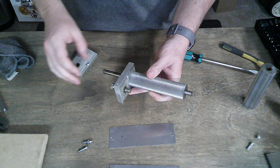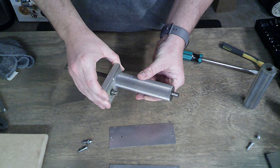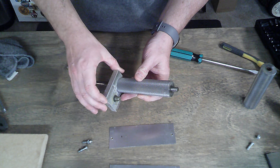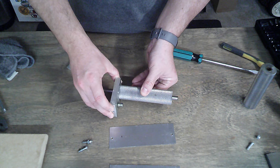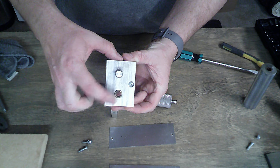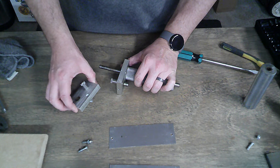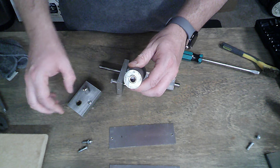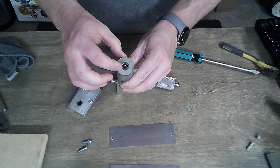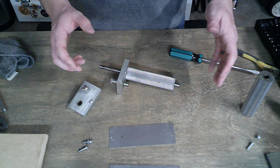At the beginning of the video I talked about using a little bit of vegetable oil to loosen things up, but you don't want to do that as you're putting it back together, because any type of wet lubricant can actually collect that dust and get stickier over time. Instead, these actually have self-lubricating brass nuts on the inside of each of the roller housings — I wouldn't put any type of lube on this once it's fully cleaned out. The same goes for the other roller: it also has those self-lubricating brass nuts on the inside.